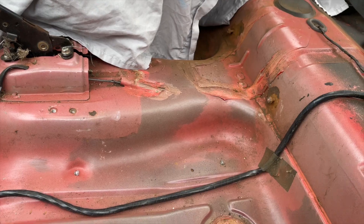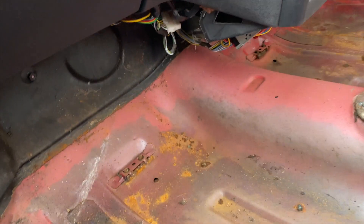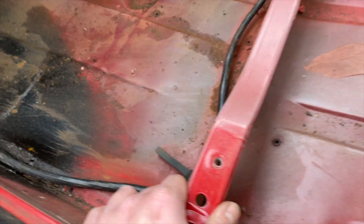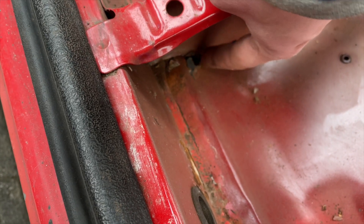Inside the car I've taken the carpet up and as you can see there's a few niggles here which I need to sort out. You can see here that a previous plate was put in, very well done actually, so I don't need to worry about that again. But you can see a little flex rust coming through on that one, as is the same with the whole of the floor pan here, so I feel I'm going to have to sort this out because I can't work out how to stop water coming into the car.